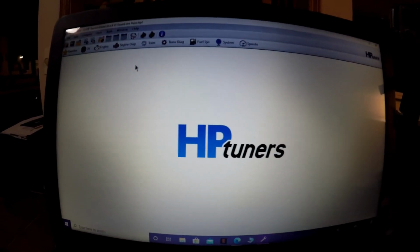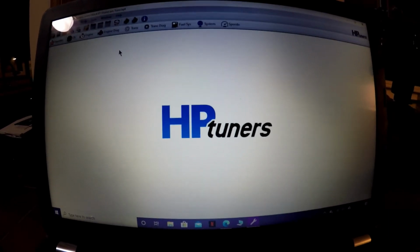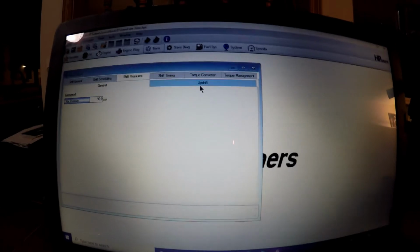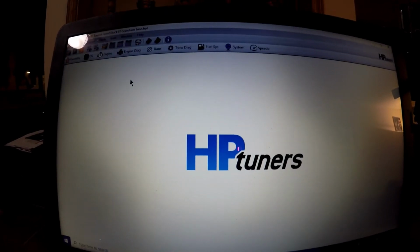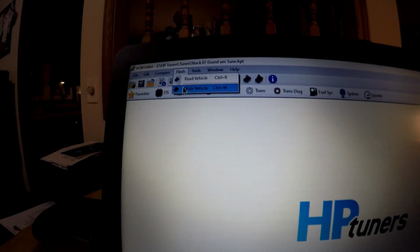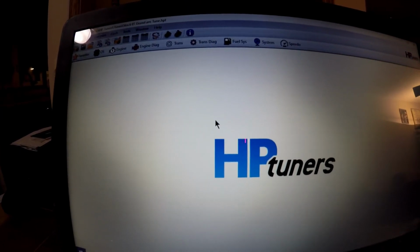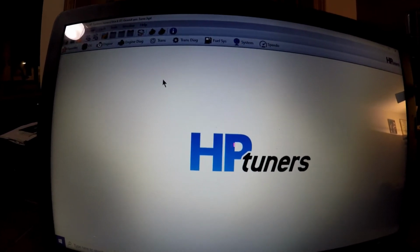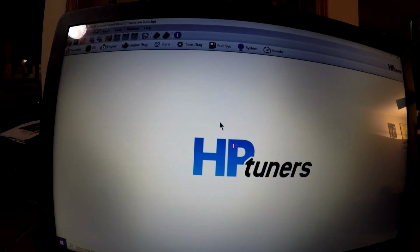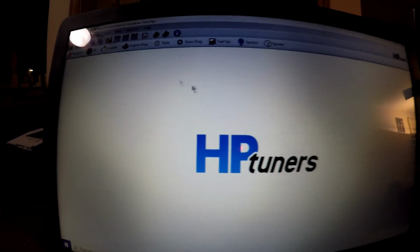Now as far as where the credits come in, as soon as you buy this and you're using this, you can read any car all day long. You decide what you want to tweak. You save that as a new file. As soon as you go to hit flash and write vehicle, that's when it'll prompt you. It'll trigger with the VIN that you're not licensed to write that VIN. So you'll either use up credits that you have or pay the money, and voila, you license that VIN number.